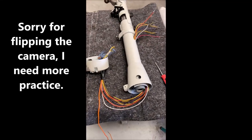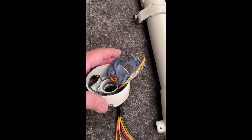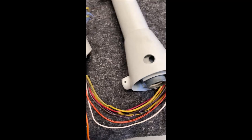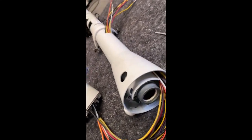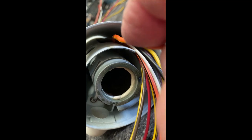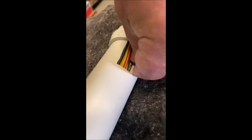Just a quick part here where I'm putting in the turn signal switch. I put it through the hub first and I've got the prindle light wire as well. You've always got to tape the top of it. I fed the wires through here two at a time — they come out here. You can see the hole in there. I'll stick that in there — there it goes. See it's sticking out there, right there, that's it.